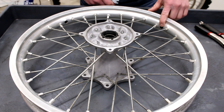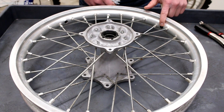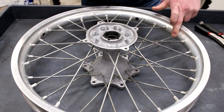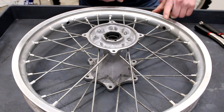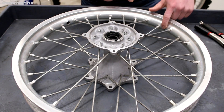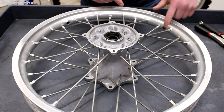The process I use for tightening spokes evenly without having to re-true the wheel: I'll start at a hole in the rim — we're going to start at the hole with a plug in it so I have something to refer to. Give your first spoke a quarter turn, skip two spokes, tighten this one — skip two, tighten, skip two, tighten all the way around until you come back to the hole. Then start at the second spoke, same process, skip two, tighten all the way around. Then go to your third spoke — by the time you've made it around on the third revolution, you will have hit every single spoke.